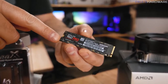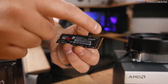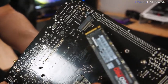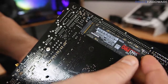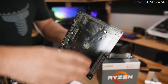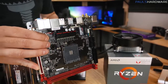If you want to upgrade and get yourself much faster storage, the next generation of SSDs look kind of like a stick of gum — this is an M.2 drive, which refers to the actual connector. It can actually mount directly to your motherboard. This motherboard has an M.2 slot on the bottom, and it is also an NVMe connection, so double-check that your motherboard has NVMe support. These are much more expensive, so going with a normal SATA SSD is perfectly fine for practical performance, but M.2 drives are an option worth knowing about.